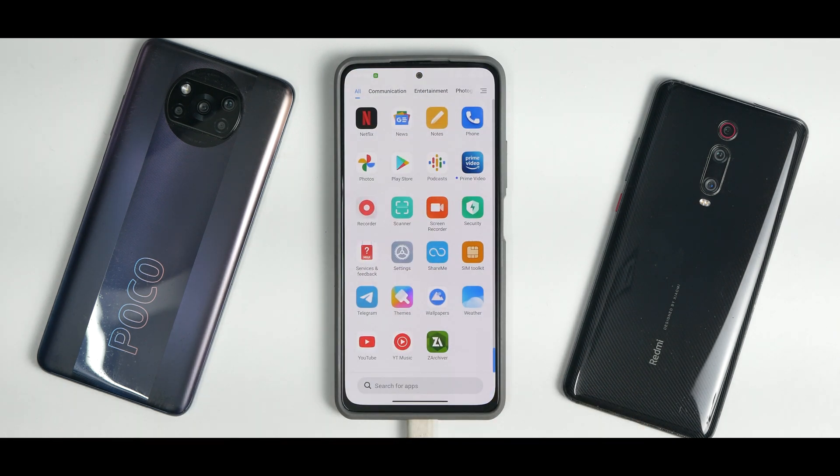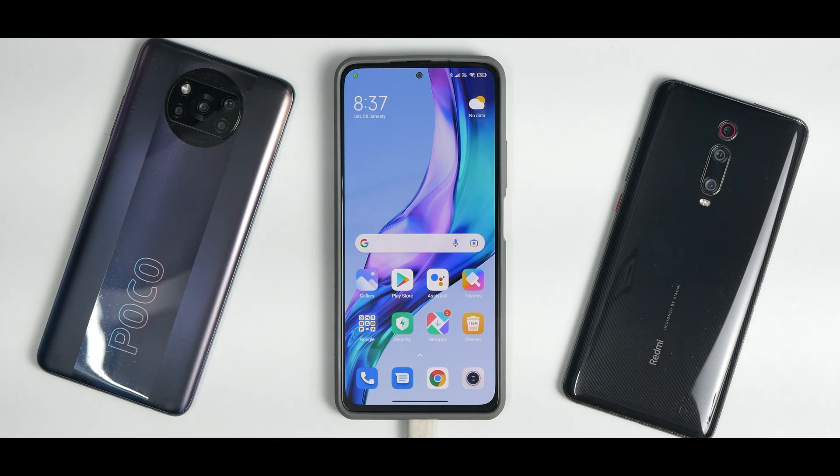Once you've taken care of all of those, there is just one file that you need — that is the MIUI 13 recovery file, which is linked in the description. It is around 3 to 3.5 gigabytes, so please make sure you have a good internet connection when you go ahead and download it. Now we are ready to flash. The reason you see a cable connected here is because I have an OTG pendrive connected and that's where my recovery file is.